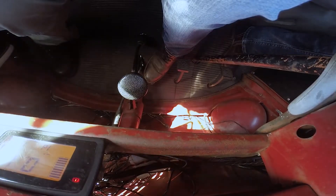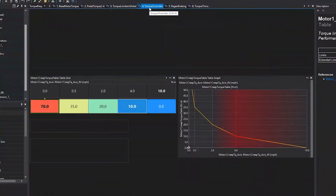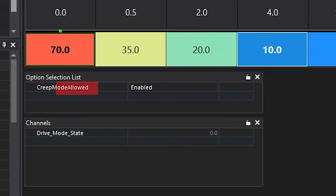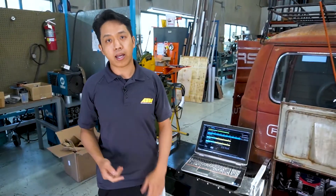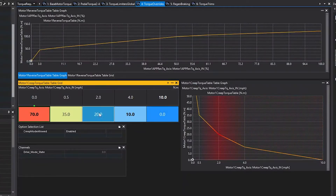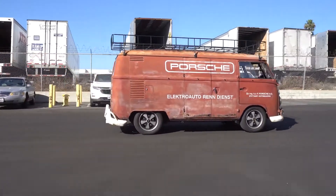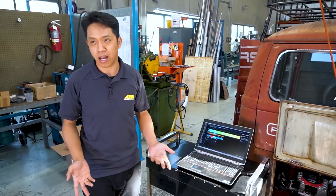The other thing we wanted to do was hill hold and creep mode, because before when this vehicle was on a hill you'd let off the brake and transition to throttle and it would roll back — kind of like a manual vehicle. Now we've made it more like an automatic where you can let off the brake pedal and it'll creep forward, so on a hill it won't roll back. Within the VCU software there's a simple 2D table that defines how much torque you command when there's zero throttle input, with vehicle speed as the axis. We're commanding a 70 Newton-meter torque command at zero speed, tapering off by 10–12 miles per hour so it gets the vehicle going but won't apply torque past a certain speed — giving you around 5 mph, like a typical automatic vehicle in creep mode.